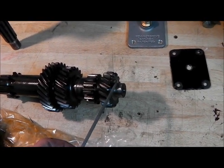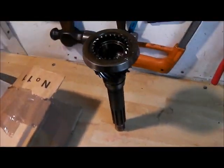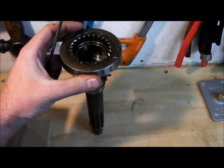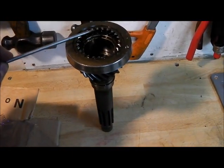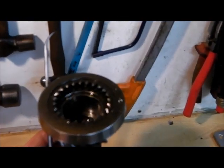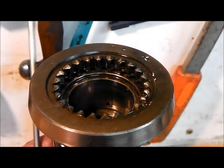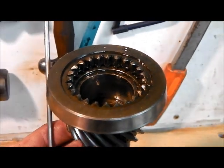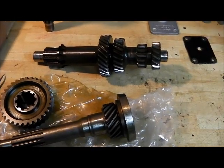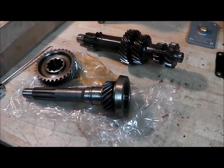There are also some little recesses in the gear teeth on the input shaft - the primary pinion rather. Confusingly we have a letter C marked on the lay shaft, but if we look at the step at the back, this is a sure identifier of this type of lay shaft - the suffix D - we have the reduced step. So we know this one's okay, so it identifies the gearbox as a suffix D.